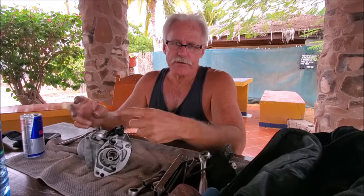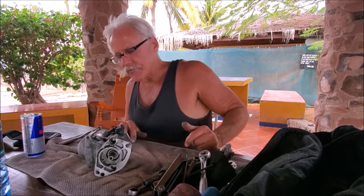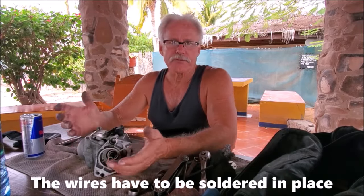The starter is an electric motor, and electric motors have these things they call brushes. There are four pieces in there that have springs behind them that push them in, and the armature in the middle spins and they push against it. Eventually they just wear down real thin — they're little metal things — and they get dirty and just stop working. More often than not you can just have the ones in your motor replaced. I've gone to starter and alternator repair shops, pulled my starter out in their yard, handed it to them, and put it back in the bike right in the parking lot.